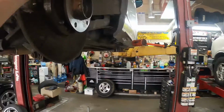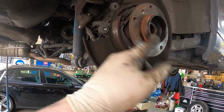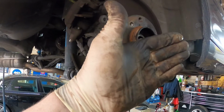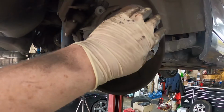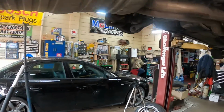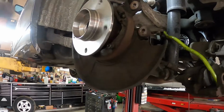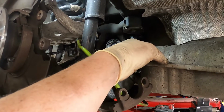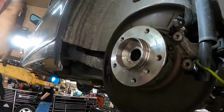We're gonna get the slide hammer over here and slide off the hub, take the snap ring out, get the hub shark in here as a receiver and receive the bearing. Get that out, and then we're going to make the hub shark the pusher, to push the bearing back in and to push the hub back on. So now I've got to do that side over there, but this side is done. So now you put your axle back in, you put your axle bolts back in, you put your sway bar up, you put your exhaust back on, then you put all your brake stuff up.